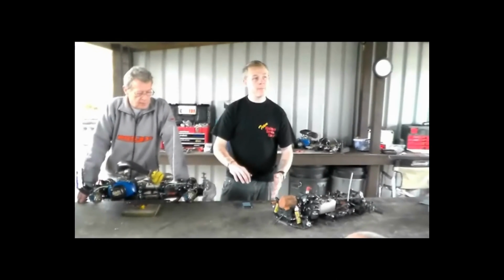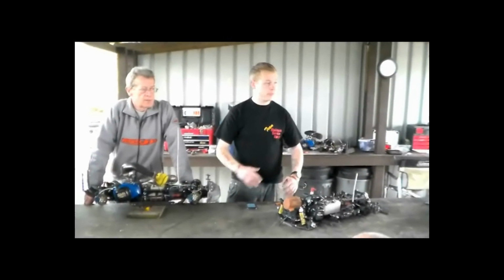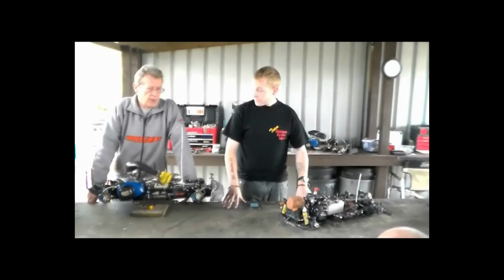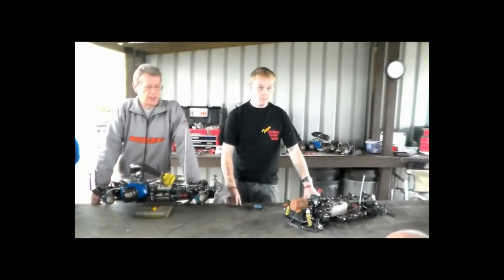So play around with it, but it's not something you should crucially change unless you feel you have to. But play around with it and see what it does. Also, a very important fact with shock oil, which people don't think about: shock oil breaks down big time. People do not think about changing shock oil.